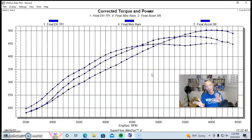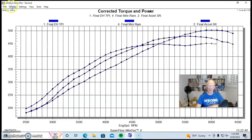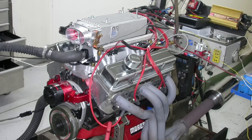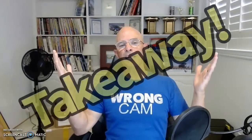As always, the longer runners always make more power down low. The question isn't how to tune for this — the question is where do you want to make power. I also ran a Stealth Ram, which has runner length between a Super Ram and a Mini Ram, and — you guessed it — it had a power curve between the Super Ram and the Mini Ram, because that's exactly what the effect of intake runner length does.